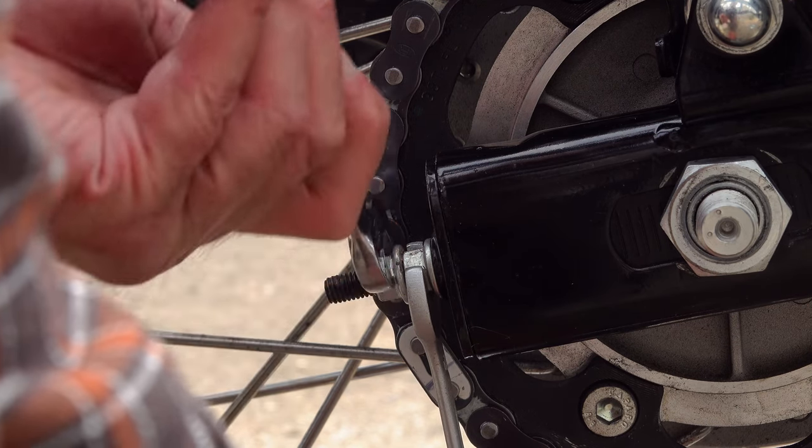And when you've done this, it's time for a general cleanup of the areas of the bike that have old chain lube fling on them. You can either use Silkaline Pro Prep, or if you have some of that pre-paint wipe by U-Pol that I use, again I'll leave links for both of those products, you can use that to clean off excess chain lube that's accumulated on various parts of the bike, like your rear swing arm, your rear wheel rim, and the accessible areas around the front sprocket. And that's it really, you're good to go.